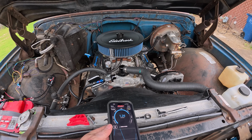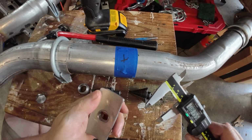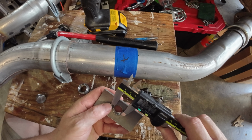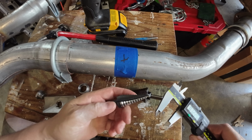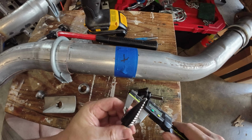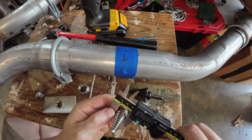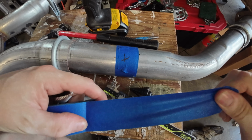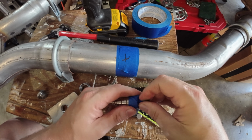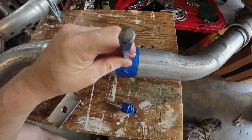It's not that complicated. Here's me installing it quite a while ago, but yeah, just simple. The O2 sensor has its own spot. Locating it is the same as you do on any. You want to make sure that it's at an angle so it's not collecting any water, and keeps the sensor as clean as possible. In this case, I've got a lot of room underneath the truck on the passenger side, so that's the exhaust side that I went into. And certainly it follows all the rules of a typical O2 sensor.